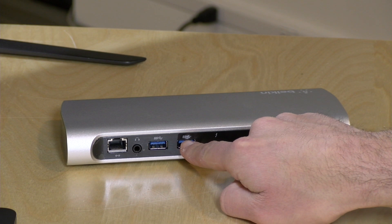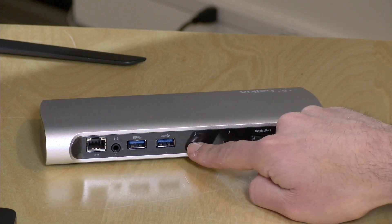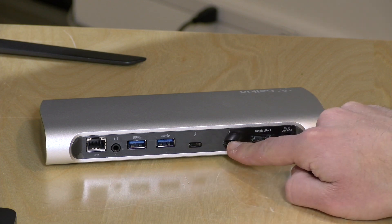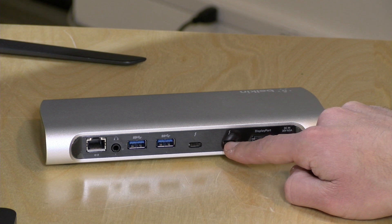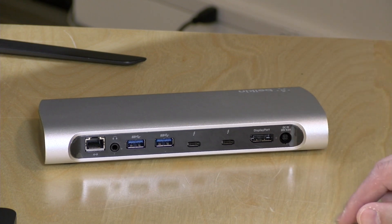You've got two more USB 3.0 ports here — we'll be testing the speed of those in a minute. You've got two Thunderbolt ports: one plugs into your computer and the other allows you to chain in additional items. You can also plug in USB Type-C devices and hook up many different Thunderbolt things, but external GPUs — eGPUs, or as Intel calls them eGFX — do not work through docks like this; they need to be directly connected to a Thunderbolt port.